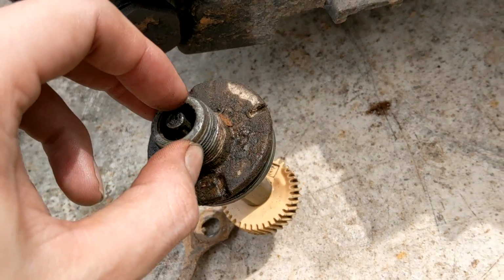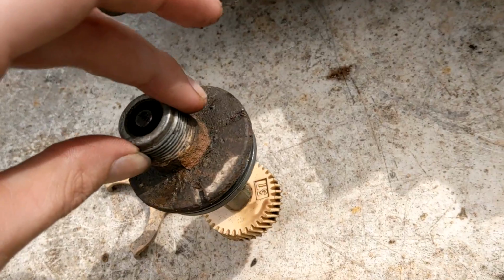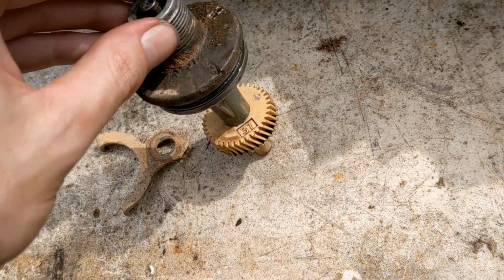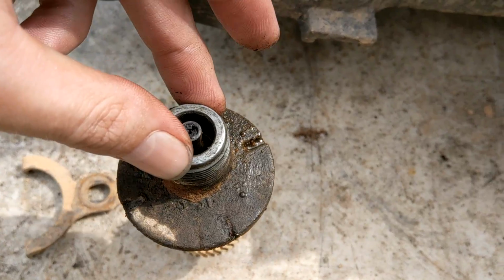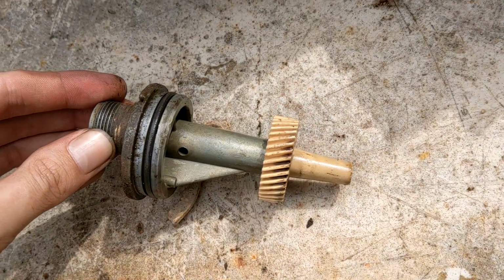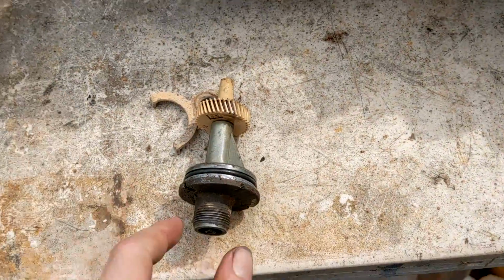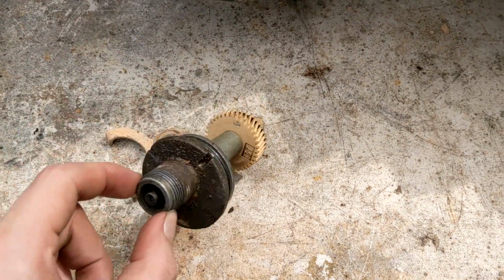If your speedometer doesn't match anymore because of your tires, this is the thing that you change to fix your speedometer so it reads properly. There are charts online where you can see your tire size versus your gear ratio to see what tooth count you need. There's a couple different pockets in here, and each one is labeled for a different number of gear teeth. Because if you notice, this is offset, so you rotate this until the gear meshes properly with the output. So just remember the teeth and the way that they went on. Mine's sturdy enough I can tell which ones were used and which ones weren't.